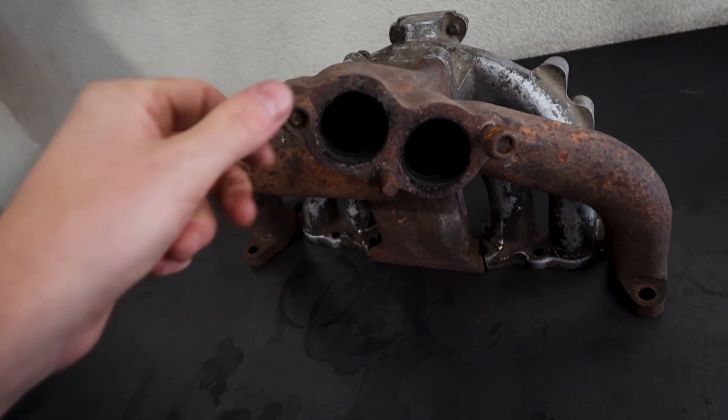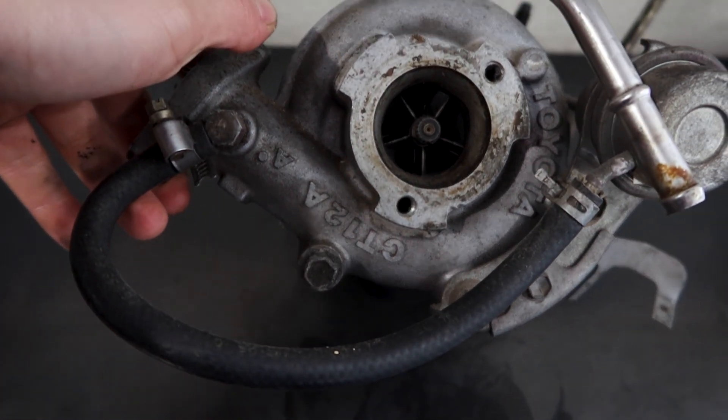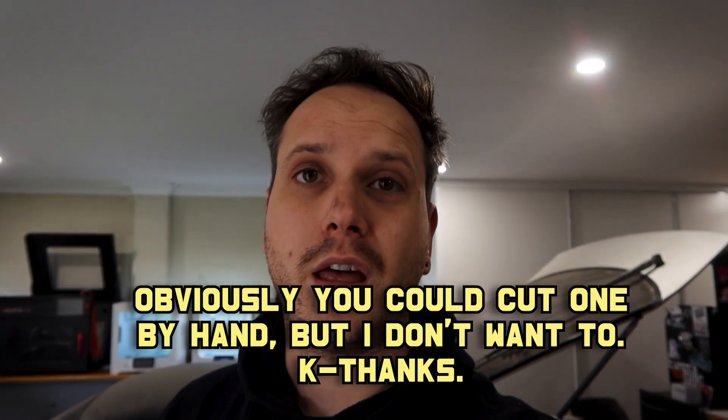So what's next? I need to design up a flange for the exhaust manifold and get ready to run the J-pipe. We're also going to need to make a decision on what turbo we're going to use. I've got quite a few laying around, so we could do some pretty cool back-to-back testing. Originally the plan was to go with a CT12 turbo which is quite small — it's off a 1J — but I've also got a T25 off a 180SX, a T28, a ball bearing and a journal bearing T28, and I think a spare 3076 as well. Regardless of which turbo I put on the end, the flange off the J won't change, so I'm going to design that up and get it printing so I can test it, then try to get one of my mates with a waterjet cutter to cut me one. Probably stick around for that one in the next episode.